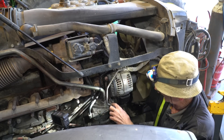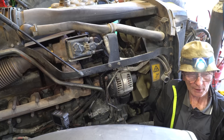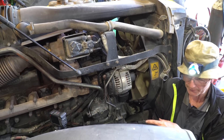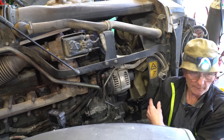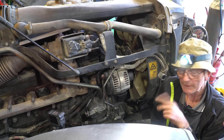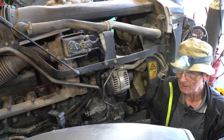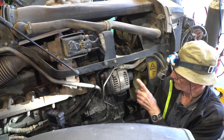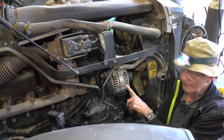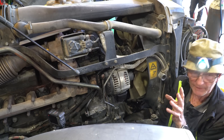We replaced the wire. The purpose of that trigger wire is that it energises the magnetic field in your alternator which gives you your output. If it needs more output, it increases and allows more - it's the signal wire to tell it about charging. Anyway, put it on, started it up, still no charge. We said right, let's see if we can get it home. We took a chance, drove it home, parked it up, put the battery on charge, pulled the alternator off and sent it in to Navin Auto Electric.